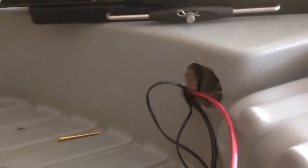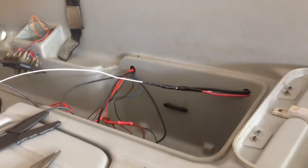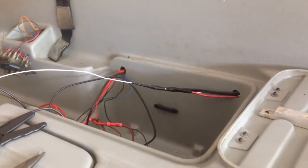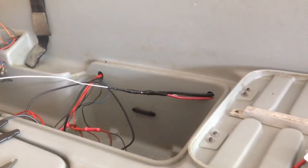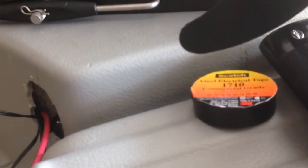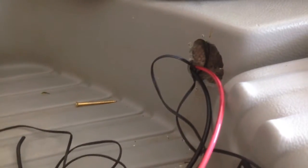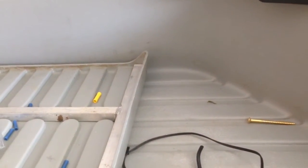Before I did that, I ran the coat hanger through there and had to kind of fish it around all that way to this point where it comes out right there. Then once I had it fed all the way through, I pulled it out of the little hole to the right and then I taped all the cables to this end using some standard electrical tape and it pulled through. There was a point right in the corner there where there's some styrofoam under there where it was breaking.